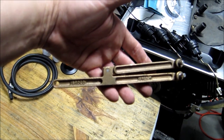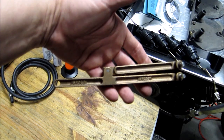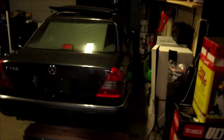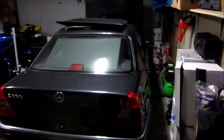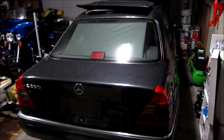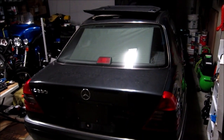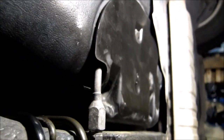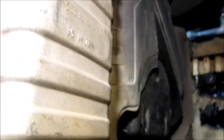That's pretty much it, but we'll see how it works. After I fill up with gas, I'm going to double check if I have any fuel leaks or not. Yesterday I was working on replacing the fuel sending unit seals, and this is the next day. I come in and I don't smell any fuel. So let's check how it looks under the car. Just looking under the car and trying to smell, everything seems dry, and that was the left hand side unit that was leaking. Let's see the right hand. Yeah, seems to be dry.